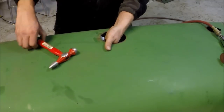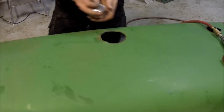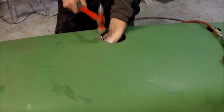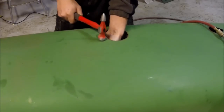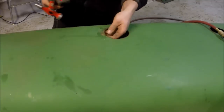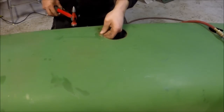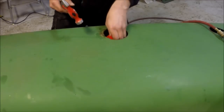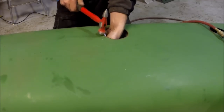So let's start fixing this shaped hole here because this one is really really dented at the end. What we need to do is first of all try to straighten it out some. This is rather thick so you need to hit it very very hard. There is plenty of rust in this end here but we are not going to do anything with it yet — we are just going to flatten it out, grind the rust away, and then add some filler to it.